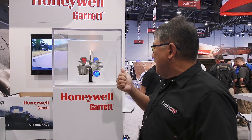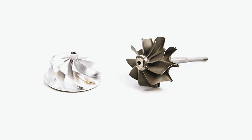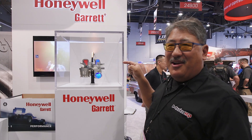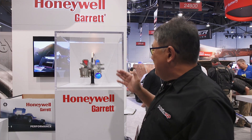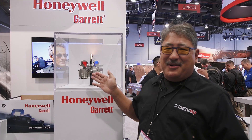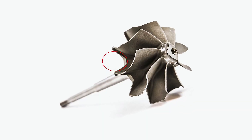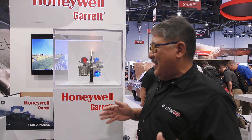It has Motorsports Aero on the compressor and the turbine. It has a supported shroud, which is really unusual for a really small frame turbo. Ball bearing center section with some things to improve the oil sealing. It also has a MAR-M turbine wheel. MAR-M is a really high-temperature alloy — not too many people use it in the aftermarket.